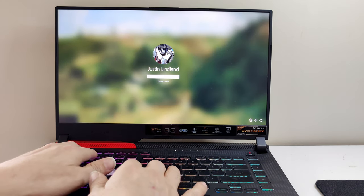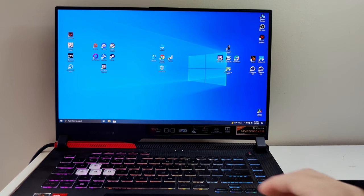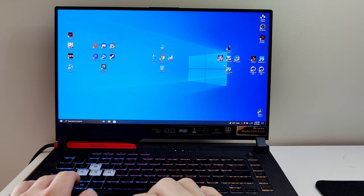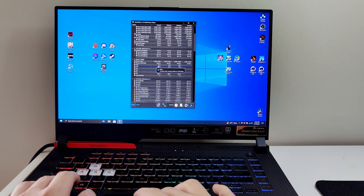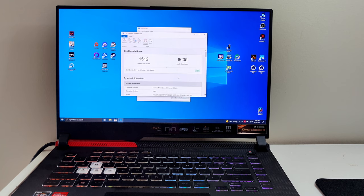All right. There's that. All righty. Now let's turn this on. Now we've got our touchpad, let's go into hardware info here and make sure our memory is running right. All right, it's running at 1600 megahertz. Let's see, all right, 20, 20, 560, and one. This was like 800 and something on my other RAM, and these were all like 22s. So we dropped two in the tCAS. Oh yeah, definitely got a boost.